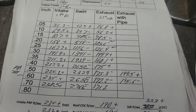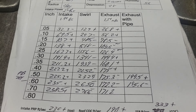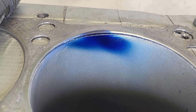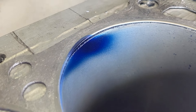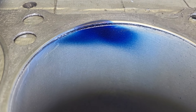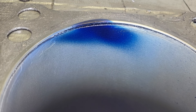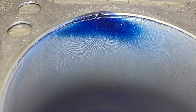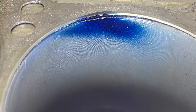I forgot to mention the bore results. Stock, that didn't look anything like this — it was a thin line. First cut looked pretty good, not quite as good as this, but that's definitely the best as of right now. Even going all the way around it just has the lightest little speckles — that's taking care of the liquid in a big way, which is helpful on a carb street application. Remember guys, it's not all about flow numbers. I push flow numbers because I want to get the most air through the smallest hole to get velocities up. The more efficient you make the port, the higher you can push those velocities and it'll still stay stable. Thanks for hanging out.